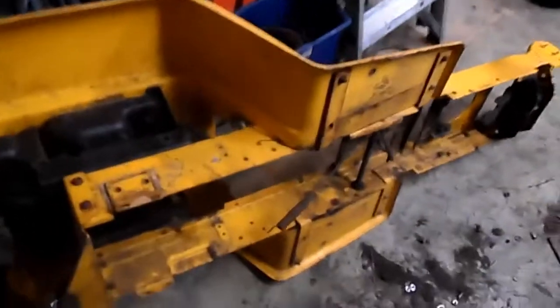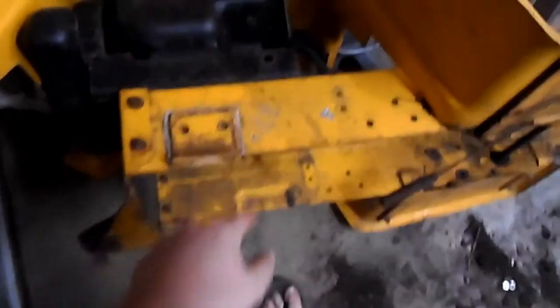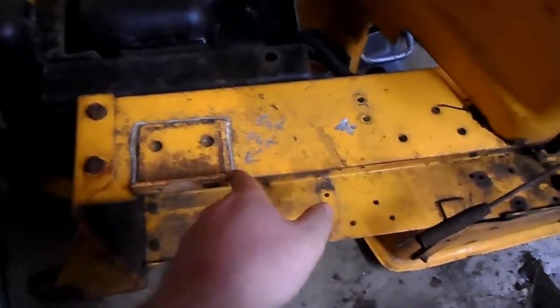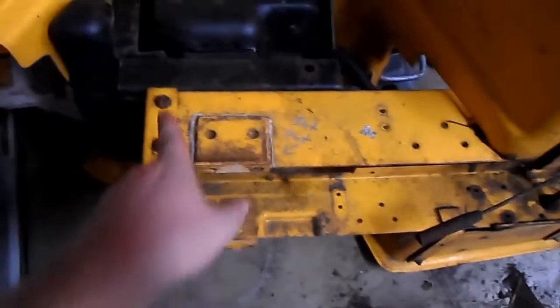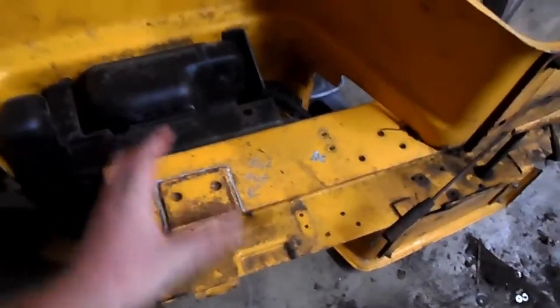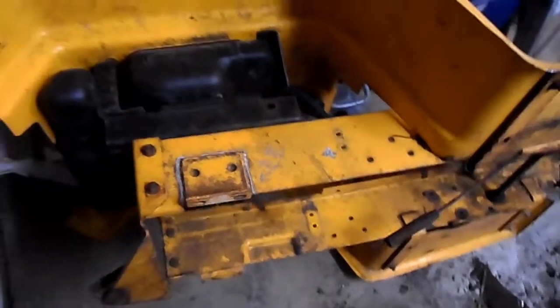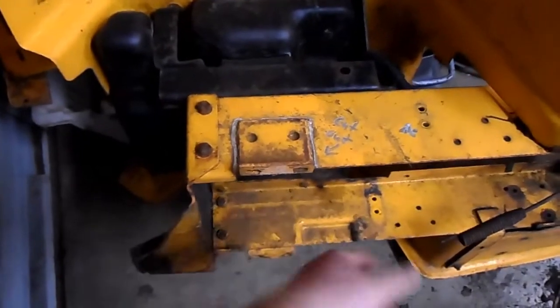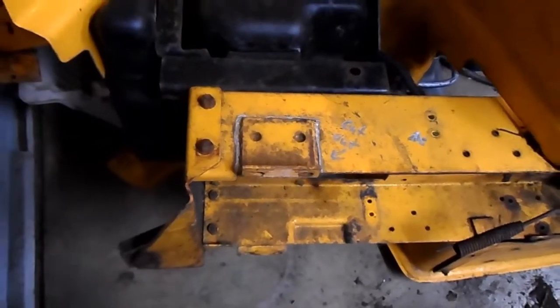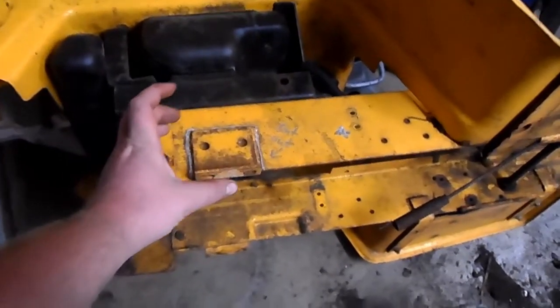Couple of things. First thing I'm going to do is cut out where my rear axle is going to go. So you see I just marked it. This was the old transmission plate for the transmission. I'm going to mark it and just cut a square out of that. Clean all this area up so when I get my cassette plates, I can weld my cassette plates in here and get my axle drop correct. And by cutting it open in the bottom and leaving the bottom open, I can drop the whole axle out on both ends completely out of the chassis without having to pull everything off and slide it out the side.